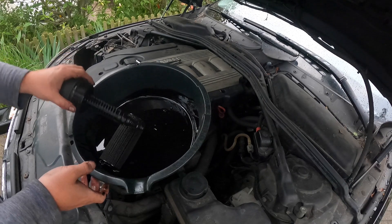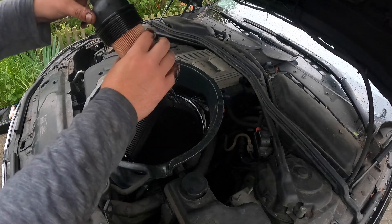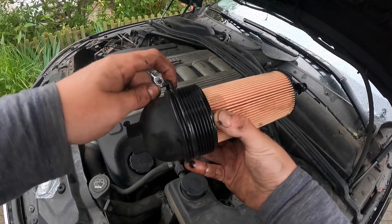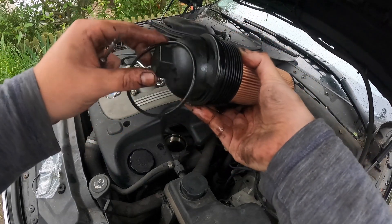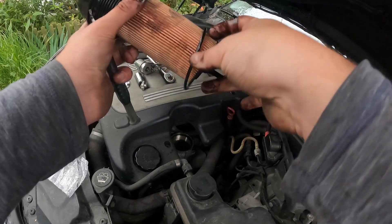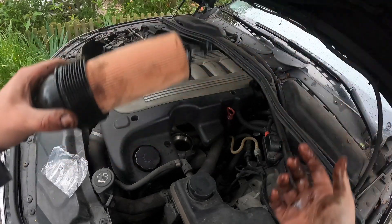This is just a press fit — there you go, it just comes off like that. Put that in there. Grab the new oil filter. So that's that on. What we'll do now is pry off this O-ring — just hook it underneath and move around to pop it off, and that goes in the bin. Grab your fresh one, put a dab of fresh oil on it, slide it in from the bottom, slip back into place, and then screw this directly back in.